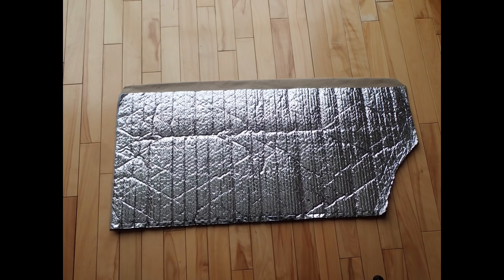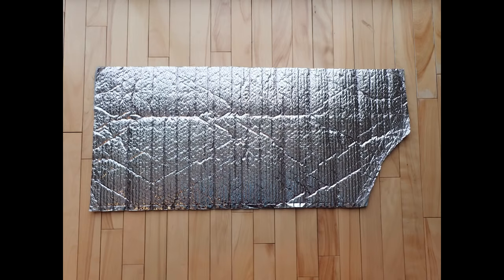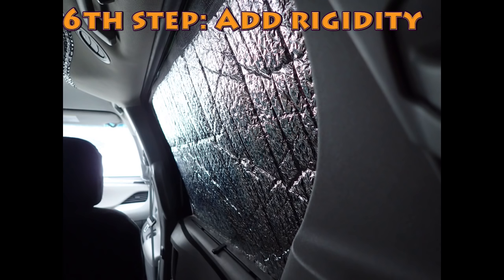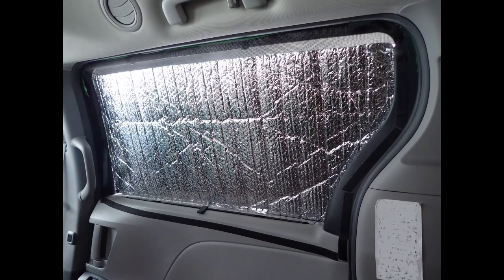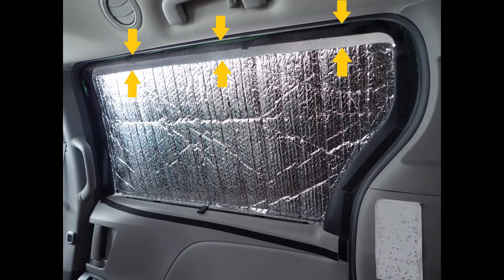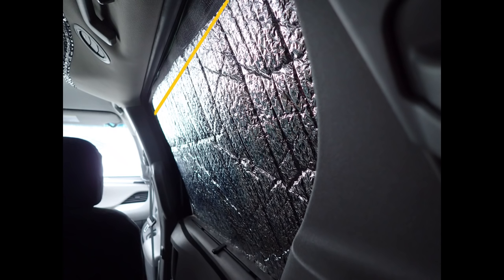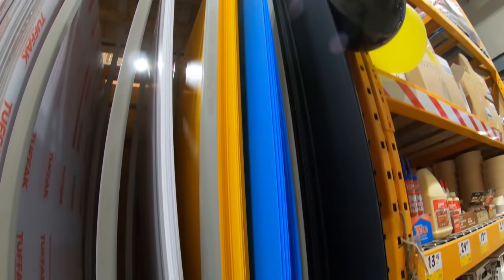If you cut the Reflectix just a little bit less than the height of the window deflector, the window deflector and the window covers will mask the window completely. Sixth step: add rigidity. If needed, add rigidity to the window covers. For a minivan, the windows are large and you may have to reinforce certain covers. Since you have cut the upper edge of the window covers to manage humidity, certain larger covers may have a harder time staying in place. There are a few ways to give rigidity, but in all the options I can think of, I always use Coroplast.